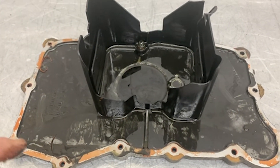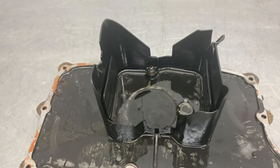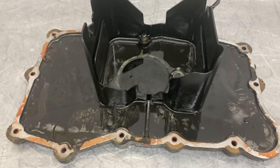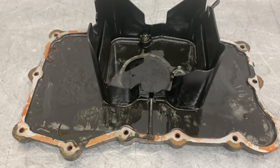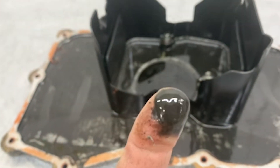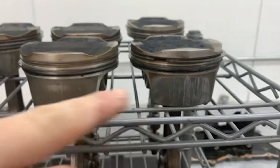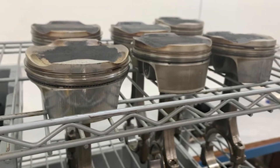Pull it off to facilitate an inspection of your cylinders from inside the sump. Follow our Focus on Bore Scoring series to be able to do that. If nothing else, pull it off and clean the trash out of it, and make sure you seal it back up with the proper sealant in the right amount — because you can put too much sealant in there and cause problems. When you see this thick nasty black stuff, you're going to find your way to flat6innovations.com and start a ticket telling us that you have classic bore scoring.